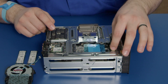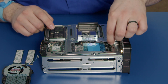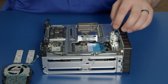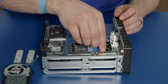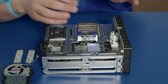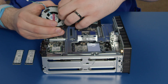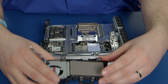I've already pulled up these little plastic clips. There are no screws or standoffs — just these little plastic clips that hold in the SSDs. Before you install SSDs, make sure you remove the plastic film that's covering the thermal pads. It's a very slippery material. You want to make sure you do the same on the heatsink — pull off these two films and then you have the thermal pads exposed.